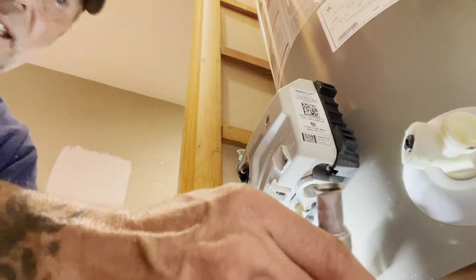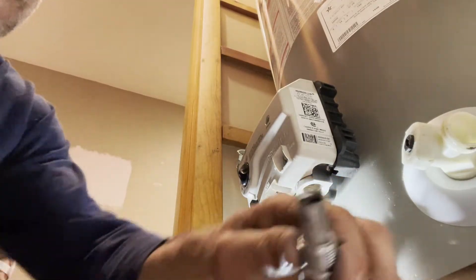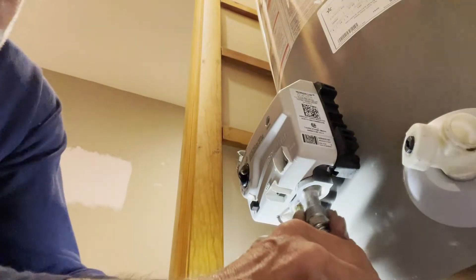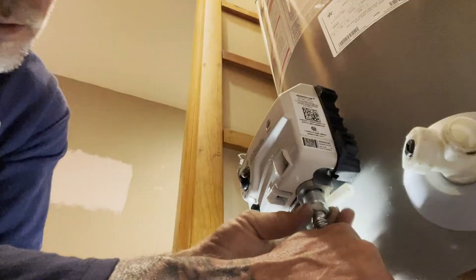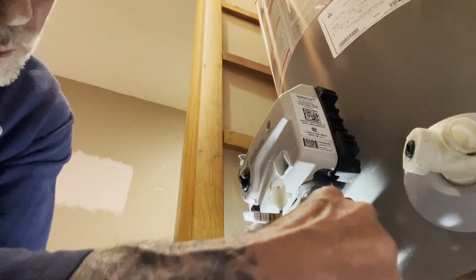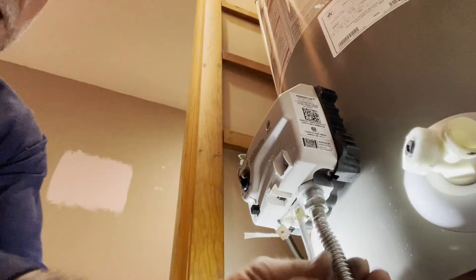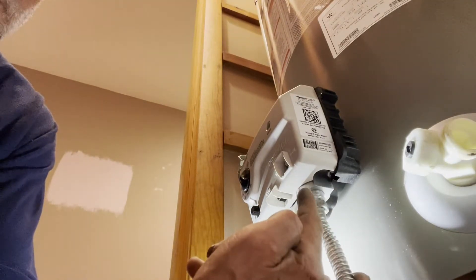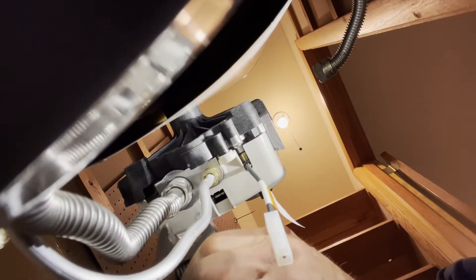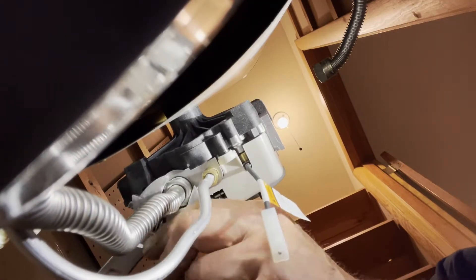Next is the flexible little line that is the feeder for the burner. It's got a flared end with a little nut. That nut slides up through there and goes into the second hole. Push it straight up and take your nut — nice and easy. We need to avoid cross-threading here, so take your time until it gets started. Keep that line shoved up in there so the flare seats on the inside, then use a little adjustable wrench to snug it up. Nice and easy, take your time — haste makes waste in this case.